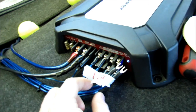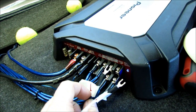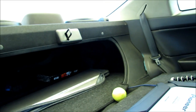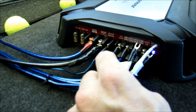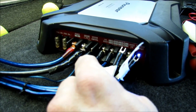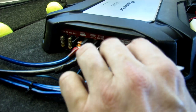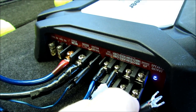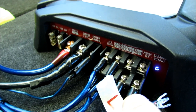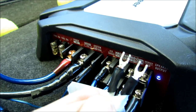I'm pleasantly surprised — on the very first wire I pulled off, the amp power light came back on and the speakers are working. I guess a speaker must be blown and shorted the system. I know you can also use the multimeter to check for four ohms at the speaker, but it's pure luck that the very first wire I pulled off was the problem one.